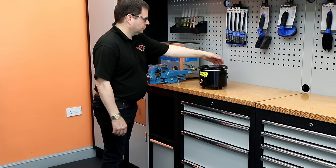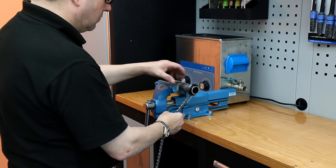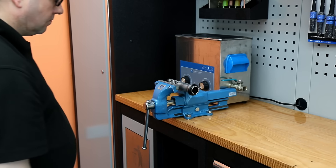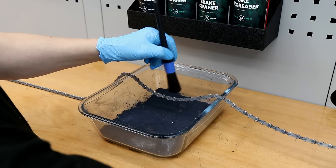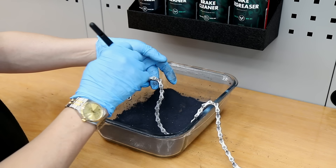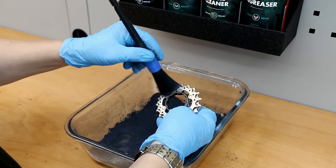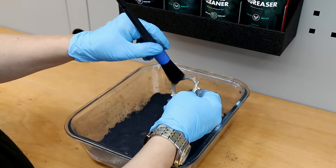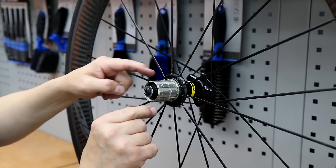Now I'm going to wax the chain — this is going in M Speed Wax. I leave it in there for about a minute to make sure the wax gets complete contact with the chain, then remove it and let it completely harden off for about 10 to 15 minutes. We can break that chain off to make sure it's nice and flexible again; the wax seeps into the rollers. Then we dust molybdenum and PTFE powder over the chain — this is supposed to give 6% less friction and is 100% water resistant. We coat the chain and also the cassette itself with the M powder; the anti-corrosive properties stop the cassette rusting so quickly.